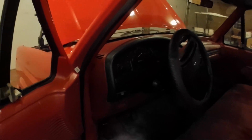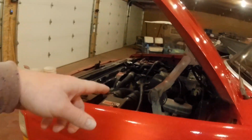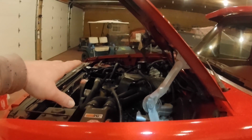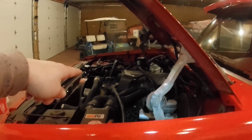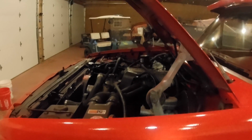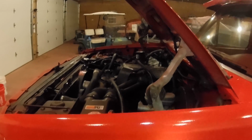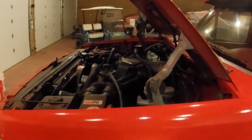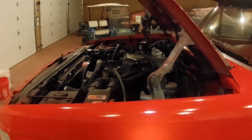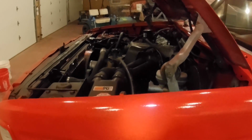We're in good shape. Now, how I did clear that check engine light, when I cleaned that sensor, I cleaned it and I cleared the light by disconnecting the battery. I was doing some other stuff out here. I think I left it unhooked for 30 minutes. Hooked it back up with that clean sensor. I ran it up and down the road a couple of times, and the check engine light has not come back on. So I think we're in good shape here.